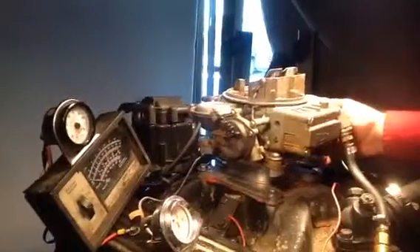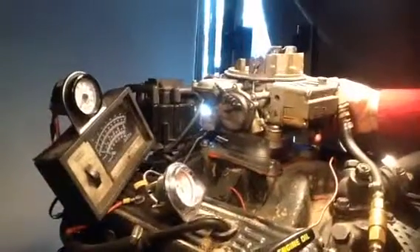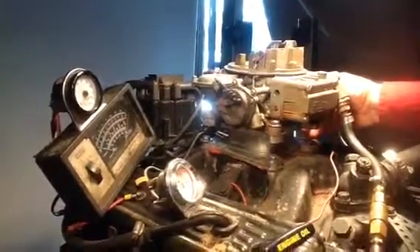So we're concluding that the carburetor is definitely bad, and we're going to carry into it and rebuild it. The mixture is pouring in at one part of gas for every eight parts of air. It should be one to twelve at least — it's one to eight. And it's only running on one side, too.